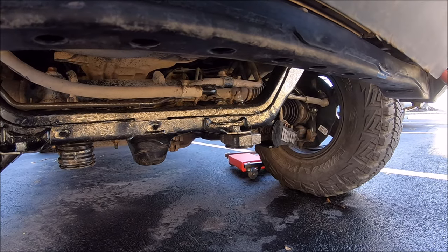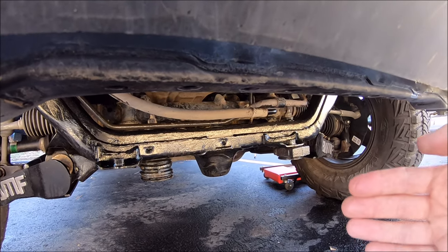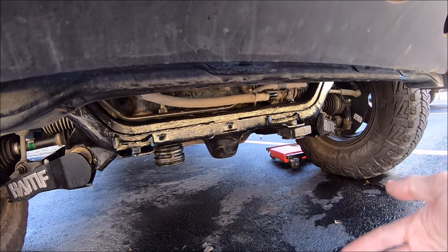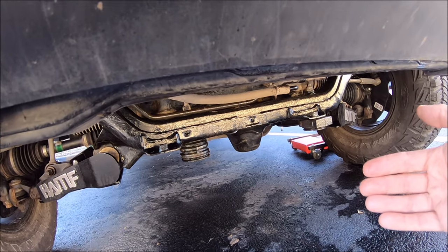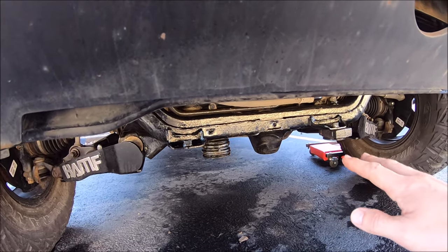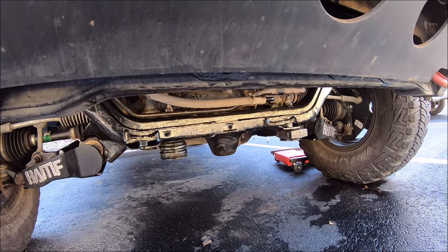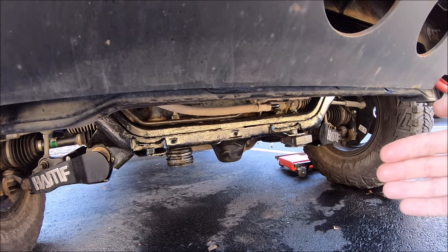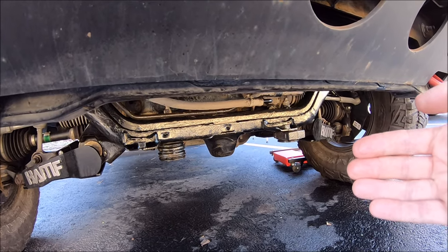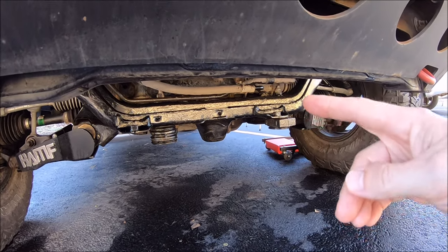Quick shot of the fluid film on all of the exterior surfaces here where I'm doing this, just to show you guys. This stuff soaks in over the next few days, sort of like lotion on your skin. Even if you clean it like I did, I guarantee you're going to find extra dirt and stuff. Don't worry, that's perfectly fine. After you give it a few days, it soaks in and it almost looks like you just painted whatever you put the fluid film on. So it gives it a nice finish, which of course is going to protect that metal surface from rust. But we are not done there.